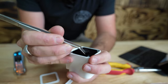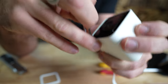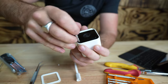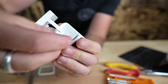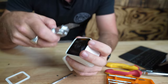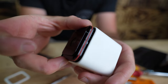You're left with the camera looking like this. Remove these rubber plugs with a pair of tweezers — they're more likely to push in than pull out, so get down beside them and drag them out. Then use a Phillips head screwdriver to take out the three screws. Make sure the SD card is removed first — the face won't come off without it. Use a knife to slide down the side and pry the front cover out. There's a rubber seal that keeps the whole unit waterproof.